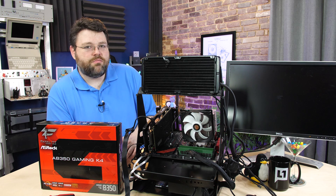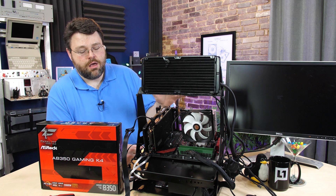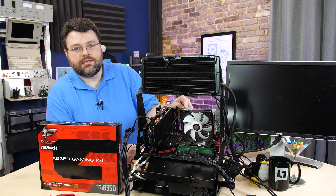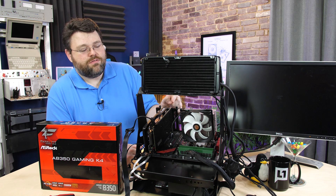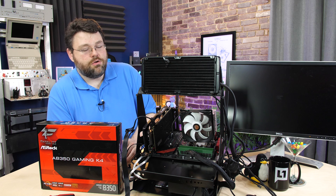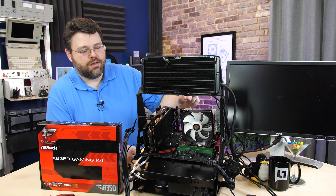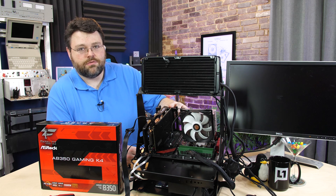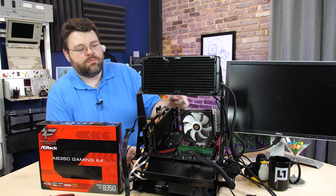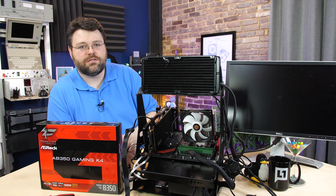The next thing you should be thinking is: what about IOMMU? This board is actually the best situation with IOMMU on a board that I've encountered so far, and the reason is because of the NVMe slot. The NVMe is in IOMMU Group 0, and the x16 slot is in IOMMU Group 2. So if you put a graphics card in the PCI Express 3.0 x4 — which is not an entirely unreasonable amount of bandwidth for a video card — you can use it in Linux. IOMMU works and you can totally use it without an ACS patch. The only catch is that the UEFI doesn't let you initialize the PCI Express x4 graphics card first. If the primary graphics card supports being re-initialized by the operating system later, you will be fine.